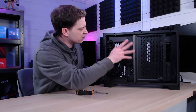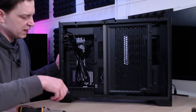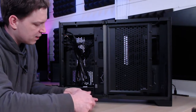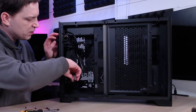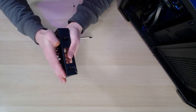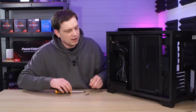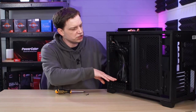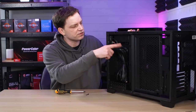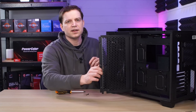Once the door is open we can start seeing what's inside — there is a bit of a cave where we can mount our power supply. There's a separate little unit here that we can unscrew, and that plate slides forward so we can take it out. This is what our power supply mounts to — we simply mount the PSU to it, click it back in using the little hooks on the back, and slide it straight back in. The cables can be bundled inside here or brought out through the gap around the back into the rest of the case.